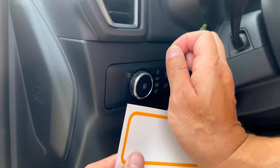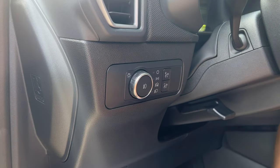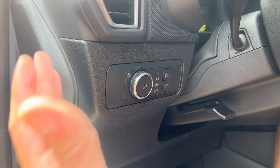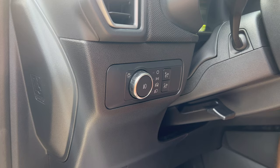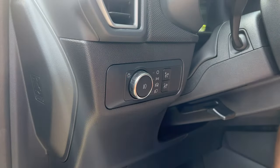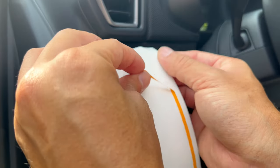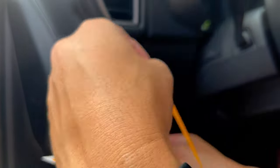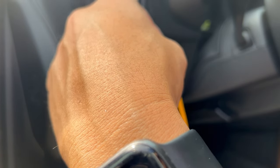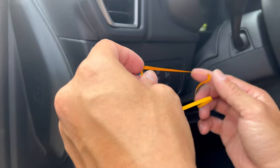You want it to be above 70 degrees, but you don't want it baking in the sun either. Especially these thin outlines can stretch out when applying them in super hot conditions. If it's super cold, you're going to have the opposite problem where it doesn't want to stick that well. At least in the interior you can heat up the vehicle — you want the vinyl and the panels to be a little warm. Let's take this off and be careful not to allow it to fold back on itself.